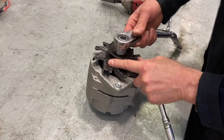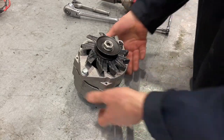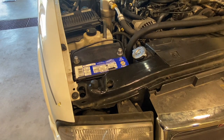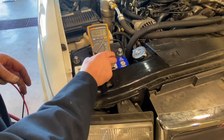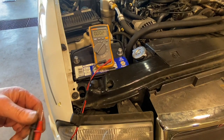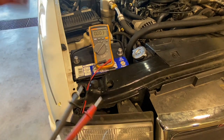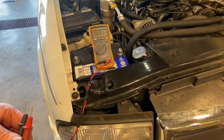This is a particular type of ratchet that has an opening in the middle for another ratchet to go through the center. That's reassembled. There are a few ways you can check to see how healthy your alternator is. We're going to show you a simple way using a voltmeter — set it on DC volts — to see if you're getting adequate voltage so it doesn't leave you stalled on the road. A good running alternator will produce a varying voltage to the battery depending on the state of the battery charge, typically 13.5 to as high as 14.8 volts, though some older Chrysler vehicles used to run up to 15.2. With some newer computerized-controlled alternator regulation, they can run a little lower to reduce drag on the engine and improve fuel economy.